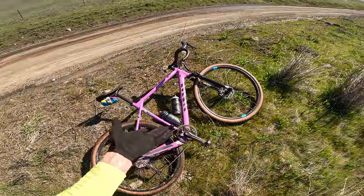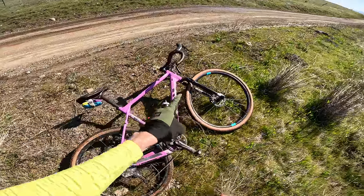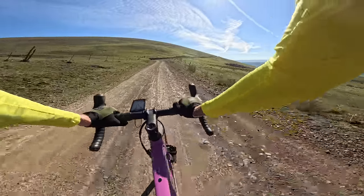So far I can't complain. This aluminum bike is a little rigid for long rides, but this fork and these wheels really do elevate the ride experience. Another thing to note with a fork like this: you're going to have to do regular maintenance, which is the same as any other suspension fork — around 50 hours. So this is an added cost and chore to consider if doing this upgrade. Is it worth it? Let's continue to find out. Next up is how this thing descends.